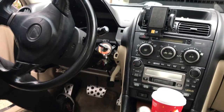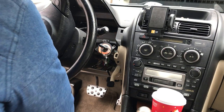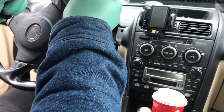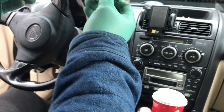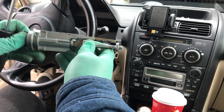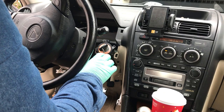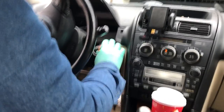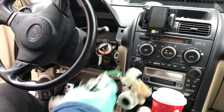That's tight back there. That's going to solve the issue with the broken shaft. Now I have complete contact between the key cylinder, which fits into the shaft, and allows the shaft to turn the switch behind it. I don't have the issue of that free play anymore. It goes to the ACC, it goes to the ON position, and I'm now actually able to start the car without reaching down there and turning the switch manually.